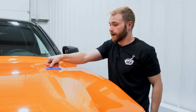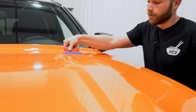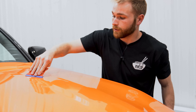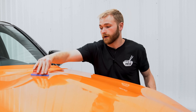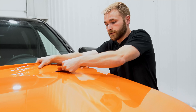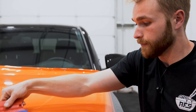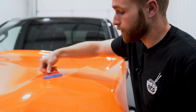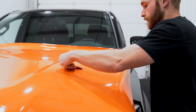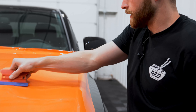Most of the time you want to tack your high body lines first. Right here we have a body line — I'm going to tack that all the way back. The reason being, it allows me to then go back and push in the recess while not creasing it on the high point of the body line itself. You always want to work towards the front or the back — that way when you do get some air, it is easier to pick up and release that air from the top or the bottom.